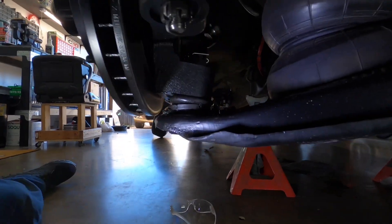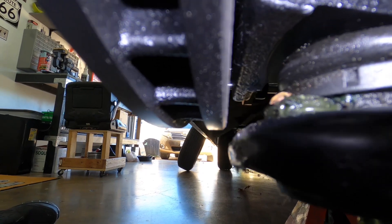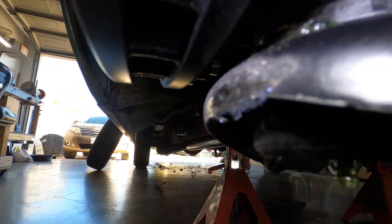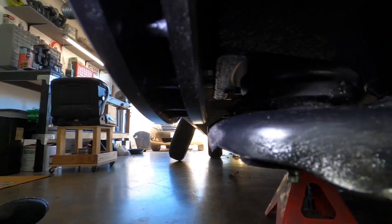All right YouTube, well on my first test drive with the brakes - look at that. What's sad about it is I never heard it when I left the house. I was listening for noises, listening for anything when I was turning. Never heard anything. I didn't start to hear it until I came back. So yeah, the rotor was coming in contact with that control arm right there.